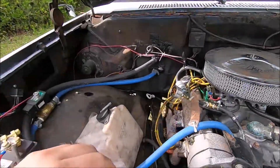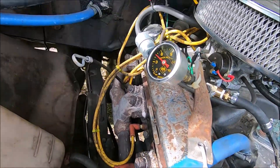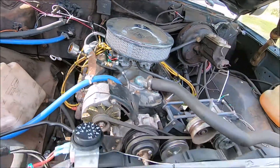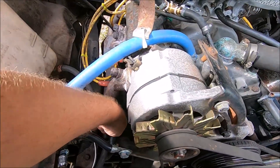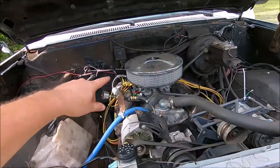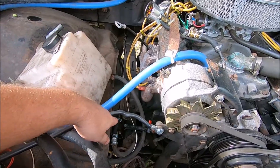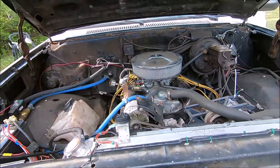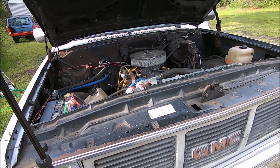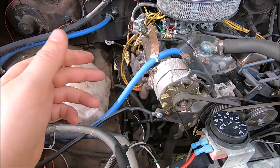The engine is off. We've still got our pressure reading. I'm going to open this valve and watch the gauge — as you can see, it drains quickly when I open it. What's happening is all the fuel pressurization slowly bleeds back through the pump and back into the return line to the tank as it sits. The longer it sits, the more fuel drains back through that return valve, because the return valve is either bad or stuck open.